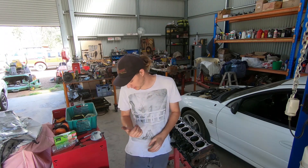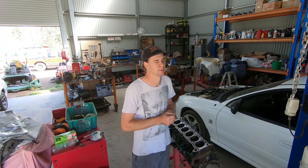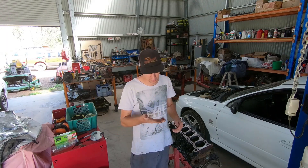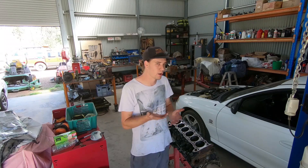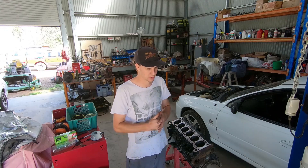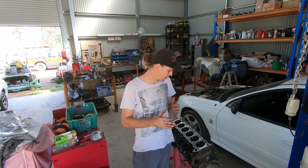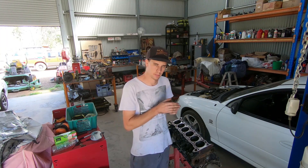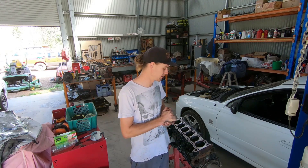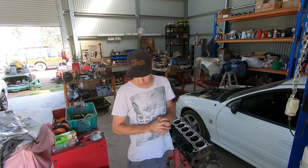For this build, because I haven't even checked what manufacturer the rings are, I'm going to go off standard RB practices for a naturally aspirated motor. The top compression ring is around 0.2 to 0.35mm, plus or minus 0.04, and the second compression ring is around 0.18 to 0.28 or so. Either way I'm not too worried about this motor particularly because it's going to be very mild - just as long as the ring gaps aren't too tight.